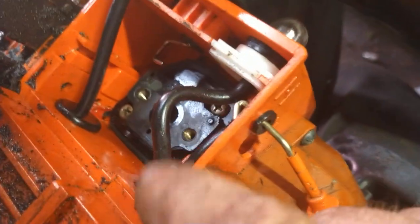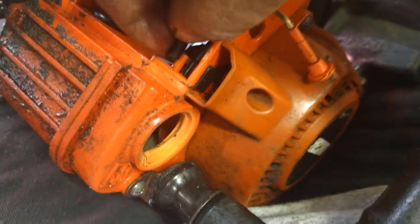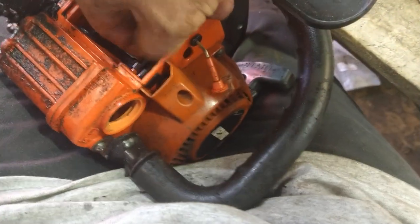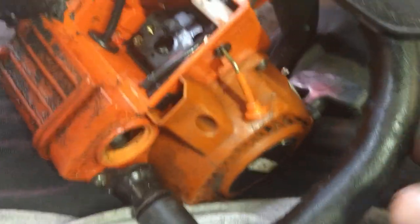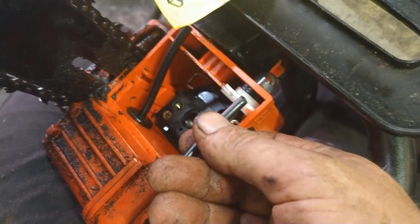This is looking a bit long, so we're going to go ahead and shorten it up — we don't want it to kink. Pull it off and cut just a little bit off. Cut it to where it's a perfect length, because if it shrinks a little bit it has some room. Get it stabbed on the nipple — it's got a slight bend in it, so if it shrinks it'll just straighten out more. That's done. Primer bulb in, return line's done.